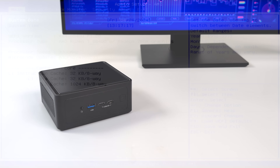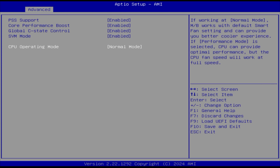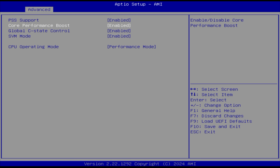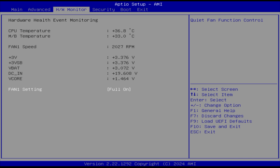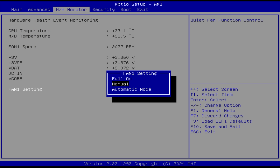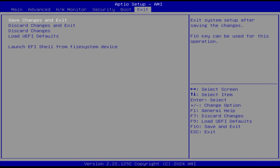Before we jump over to Windows, I want to show you one important setting in the BIOS. Once you boot these up for the very first time, it's going to be in normal mode. With the 8840U, that's about 28 watts with a little boost up to around 30. What we want to do is go to performance mode — that way we can boost up to 45 watts with this unit. There's not much else we can change for power in the basic BIOS, so we don't have full control over performance. I have tested something known as Smokeless UMAF, and we can get into the hidden AMD settings with most systems, but for this video we're just going to be in performance mode. Under hardware monitor we've got automatic, manual, or full-on fan modes — I'm just going to use automatic. Going to performance mode on these ASRock PCs is a must if you're going to be gaming on it.